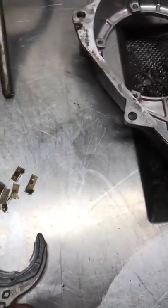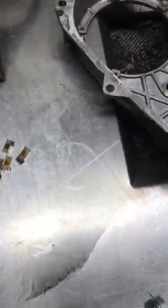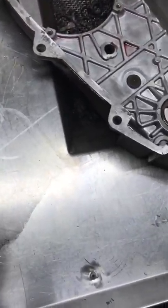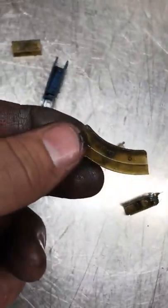What Dodge did — and when I say they, it's Dodge in their genius mindset — was to take a shift fork for two-wheel drive/four-wheel drive and to take up tolerances, they have these little plastic pieces that fit right on there. As soon as it gets hot, plastic melts. You can see every one of them is scarred up, and this is a typical rebuild — every one of them always gets changed.